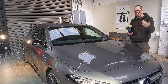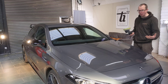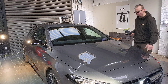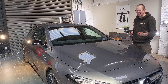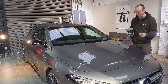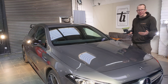The main topic today is what I call landmarks. One of the really common things we see is when doing a lot of correction — we might split the bonnet into four sections using the contour lines. This main section of the bonnet I'd typically split into anywhere between four, six, or eight panels depending on how much correction we want. For a light polish like this on a brand new car, I'd probably split into fours or sixes.